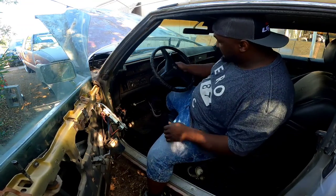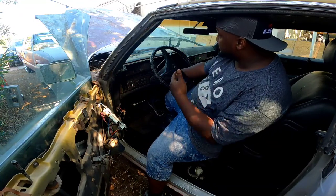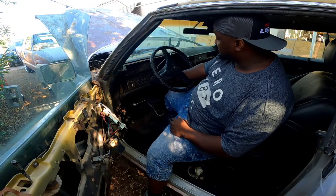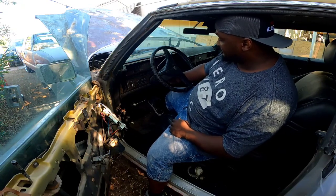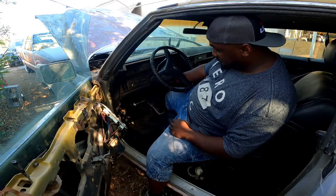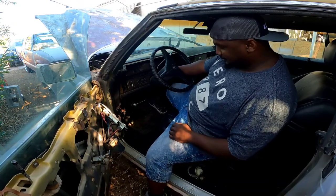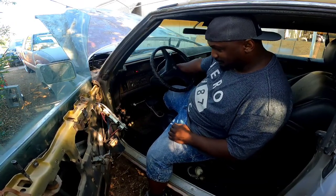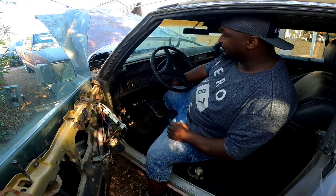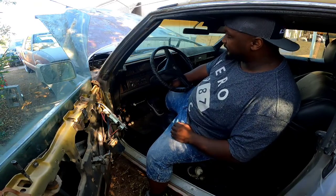Now see, I didn't pat the gas because when I did pump the accelerator a little bit up under the hood, it did squirt a little, but nothing. But this is what I've been having to go through, get this thing cranked. I just gave her about 20 pats there and she still ain't doing nothing. So that accelerator pump is shot.